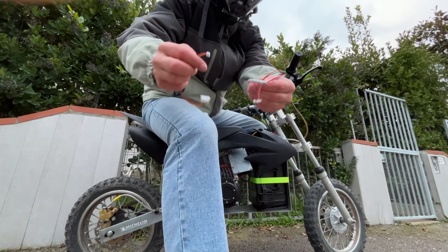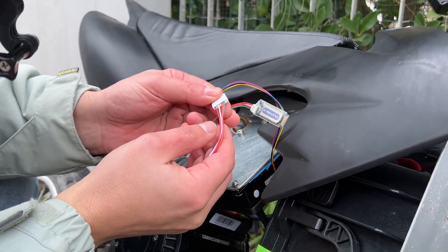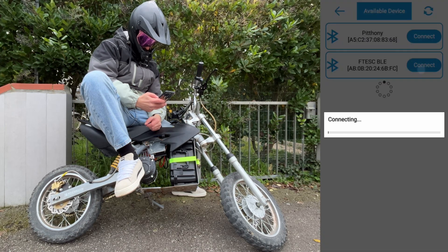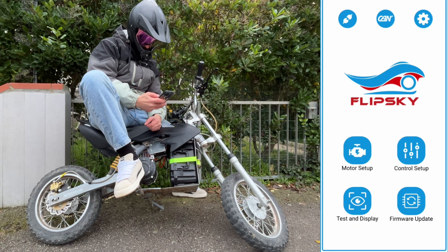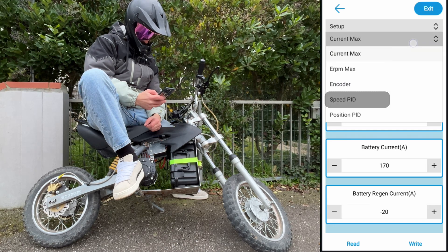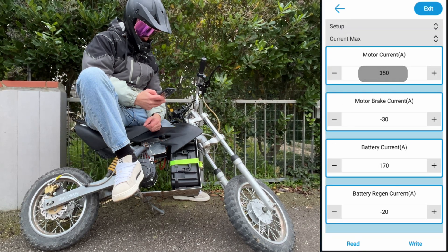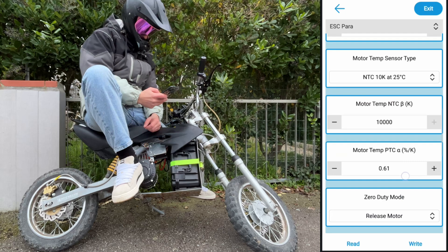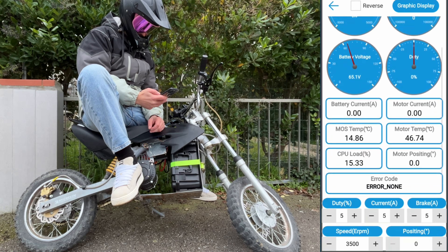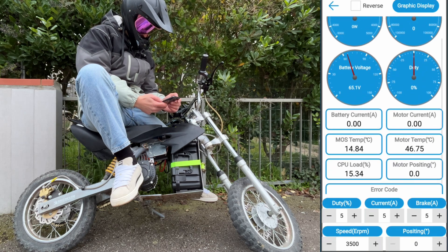Let me connect the Bluetooth module real quick — this thing is mandatory if you want to tune your ride while testing. Just download the app from the QR code and you're good to go. You can do everything from here: motor identification, control setup, and most importantly monitoring all the stats. Right now throttle is at level 4 so there's zero lag when asking for power. With 100 amps of field weakening I gained so much more torque and max speed, and there's still room for improvement. This upgrade is definitely worth it — hope you guys enjoyed the video, see you next time, ciao!